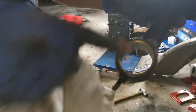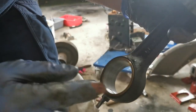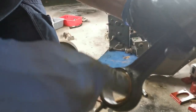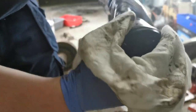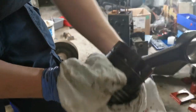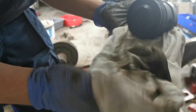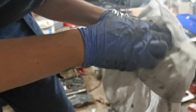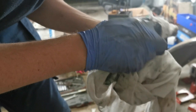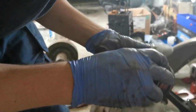Okay, so what I'm looking for in the big end bearing here, which is this lad. Have you ever heard of anybody referring to worn big ends? That's this lad. The bearing from the conrod, which is this, that goes onto the crankshaft. And the crankshaft is the part that turns the up and down motion, the oscillating motion, into a rotational motion. Words fail me at the moment. I'm sure there's a way of describing that sounds more specific, more scientific, but in a moment that'll do. You get the gist. It's like your feet on the pedals of a bicycle.